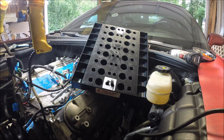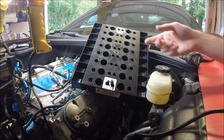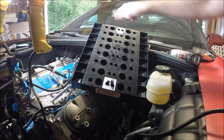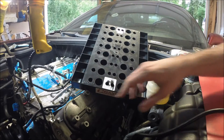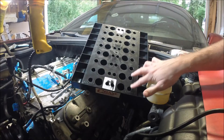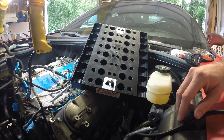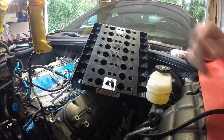To help keep things organized, I bought this tray — it's from Crane Cams, it's labeled front and back — so to help you keep up with what cylinder your rocker arms, your push rods, and your lifters come out of, if you find a bent rocker or push rod or something of that nature.